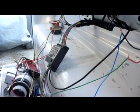Since this fuse might not be found by the next person, I'm going to put a little sticker here saying it's here. There's just a little cover held by two clips that you wind out — the cover comes down and you can see everything. I tucked the cable in underneath the plastic and it runs back here by the passenger seat, going into the back of the van all the way up to my bypass relay.